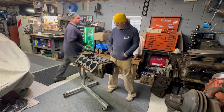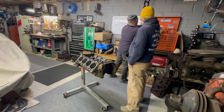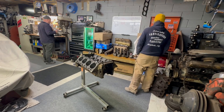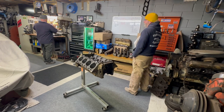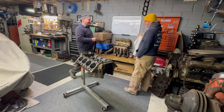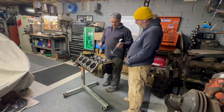What I want to do is measure according to — we're not going to use the Mondello stuff. We're going to use the actual factory assembly manual pages. I don't like that bore gauge. We don't have any other options, because that's our bore gauge. I'm using it — I paid a lot of money for it. And all we're really going to do is zero out each cylinder.